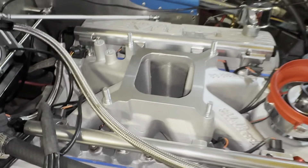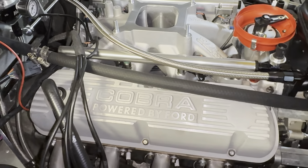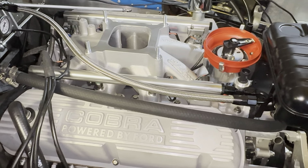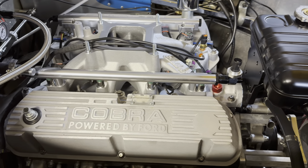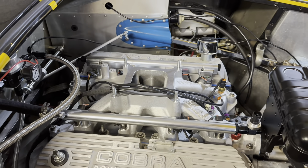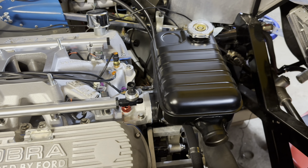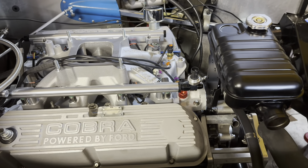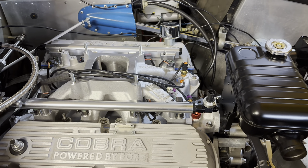So what I need to do — as you can see, I've removed the throttle body and already removed the cap and wires. The process is now going to be slowly getting everything pulled off. I'm going to pull the valve covers, pull the distributor, pull the intake, all that fun stuff. Everything is disconnected. The heater hose line has been removed, the PCV hose that was in the top of the valve cover is disconnected, the fuel line disconnected, all the wiring is disconnected and free, and the distributor is out. Everything is just sitting in the trunk of the car. Next on the list is to loosen up all the bolts for the actual manifold. I'm going to try and pull it with the tank attached, because I don't want to mess up the flange or damage the tank — I should be able to take it all off as one joined part if I'm careful.